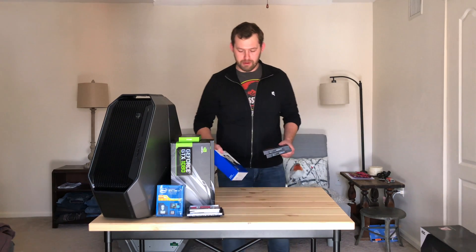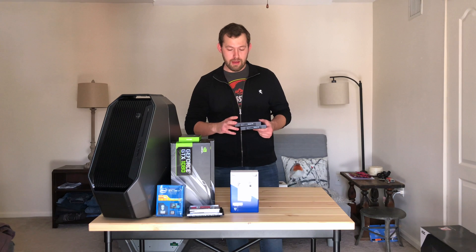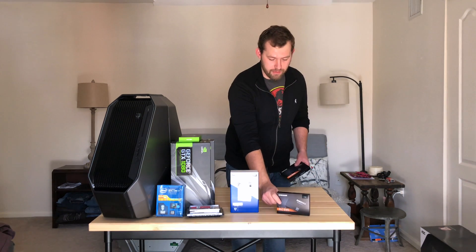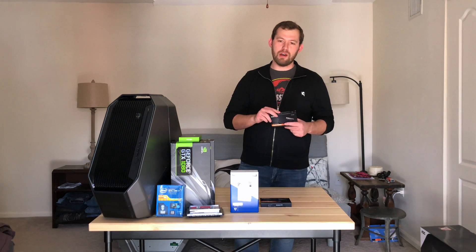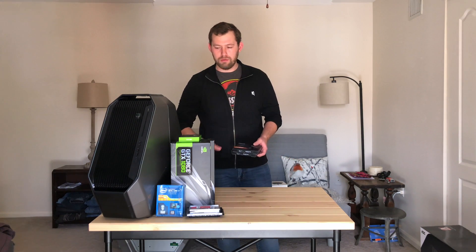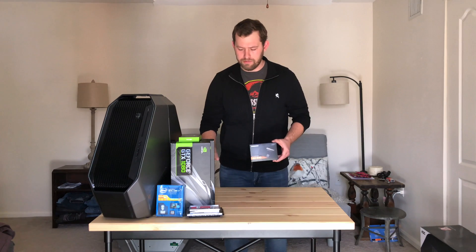Leave your comments — let me know if I'm crazy for only putting 16GB in a machine with a 5960X and two GTX 1080s. It does seem a little weird, but I think it's going to be quite all right. For storage, we've got a couple of options. We have a Western Digital Blue 1TB 7200 RPM drive as our storage drive. We have a 1TB Samsung 860 EVO as our main drive with the OS, and an additional 250GB Samsung 850 EVO as a backup or secondary storage drive. The Area 51 R2 has room for two 2.5-inch drives and about three 3.5-inch drives, so we should be totally fine.